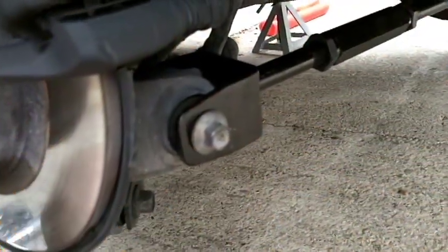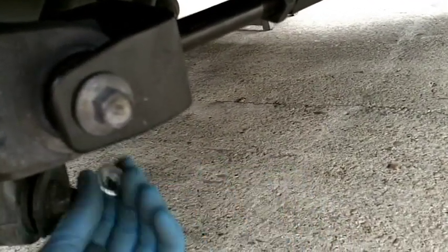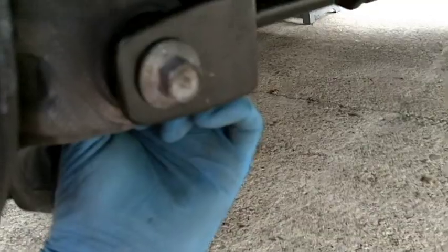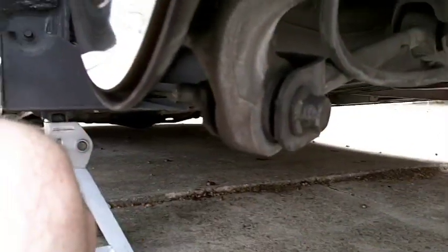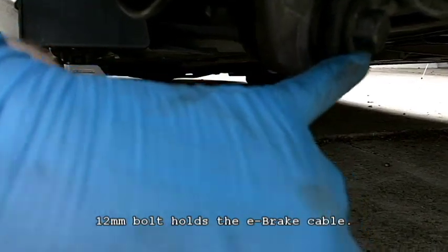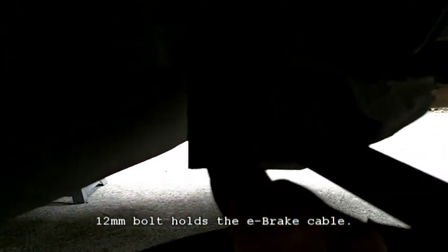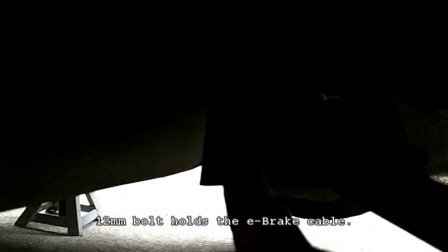So after you put the rear camber arm back on, you got to use your first of two nuts. It's going to go again on the front side. Next we switch over to a 17mm. We got this lower end bolt here, and we come around and there's a looks like a 14 right there, and there's a nut on the other side.